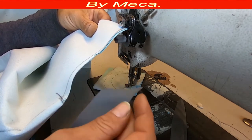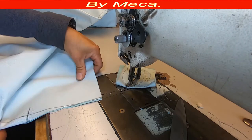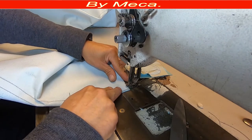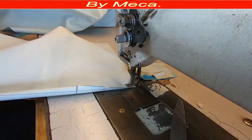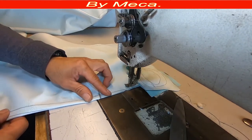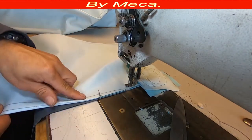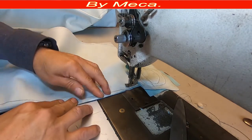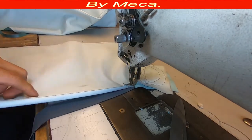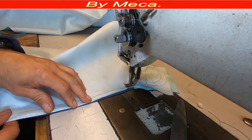I just fold the material and put the listing three fingers away from that mark. This is what I do most of the time, but sometimes you have to put the listing all the way across. My machine stitch is on 12 right now — the biggest is 5 and the smallest is 24. I start sewing little by little, making sure to go exactly on top of the mark. That's very important. When you have experience, it's not necessary to draw multiple lines — just the one from the center.